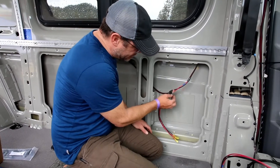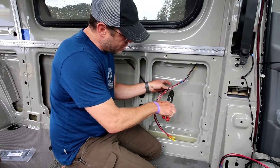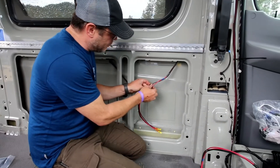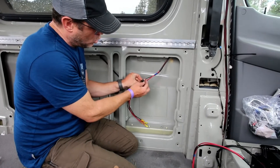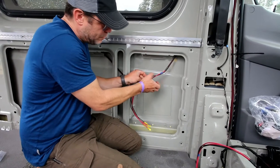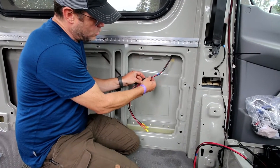The important thing with this is that when you crimp, you're not cutting through the heat shrink. And when you shrink with a heat gun, of course you're going to avoid any burn. The critical point here is that you're heating up all of the glue that is on the inside of this butt connector, and that will fasten itself really hard to the wire itself.